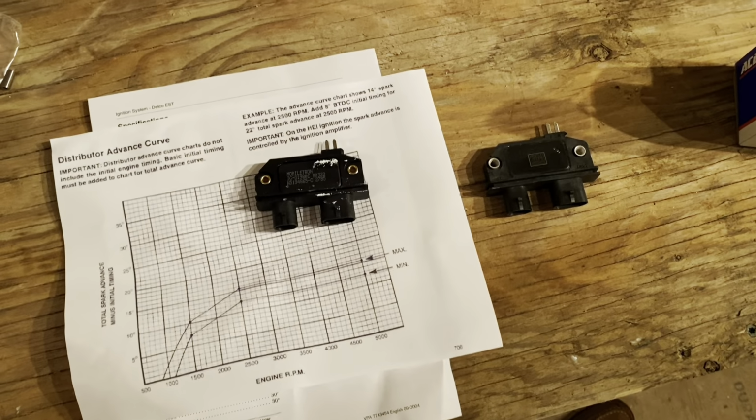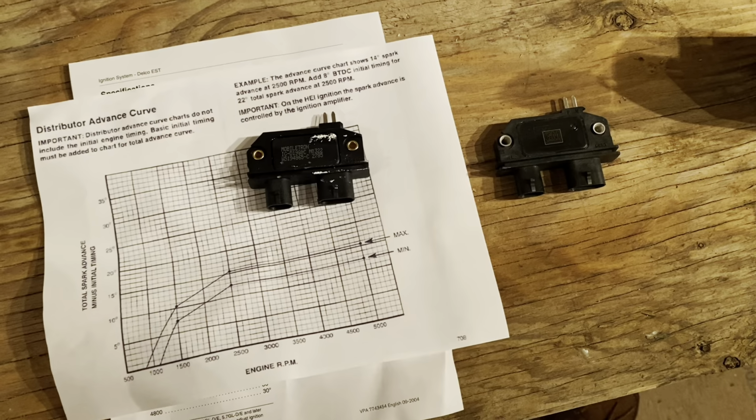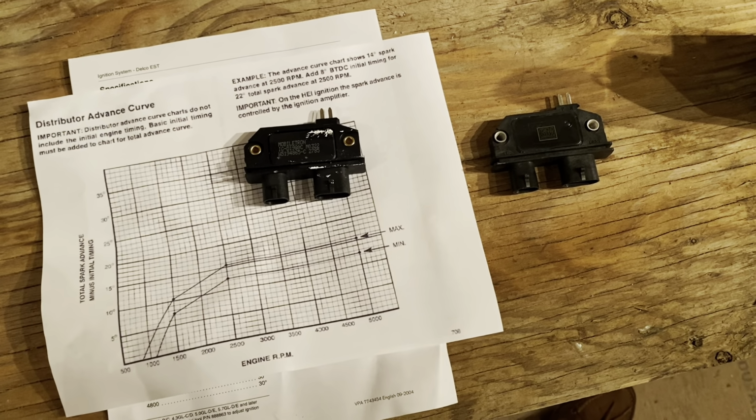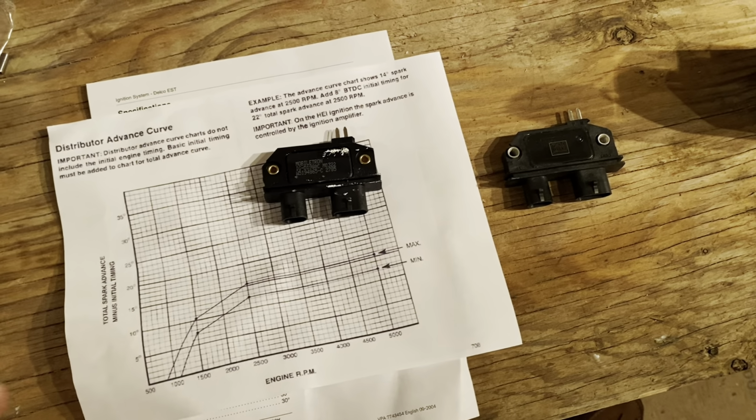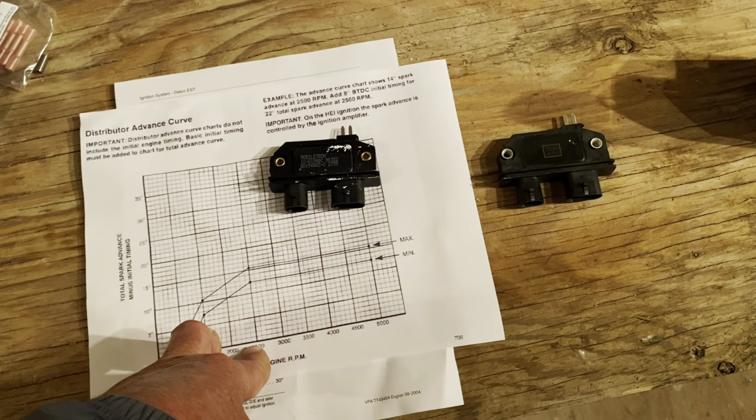The computers also happen to have a built-in analog fuel mode, and it was run off a chip called a NetRes, a network resistor. It was just analog based on resistors in the system. And that was a backup fueling mode from the early General Motors computers.